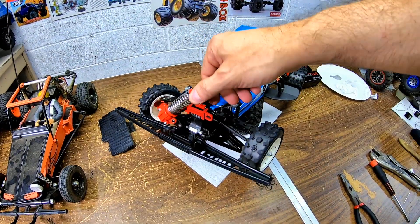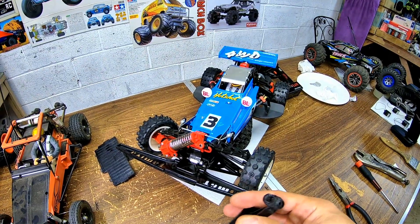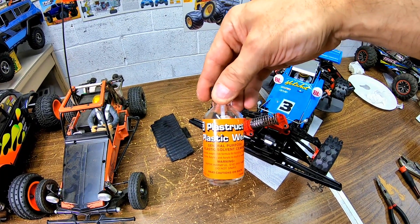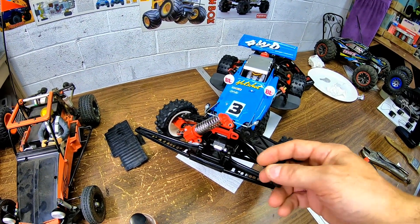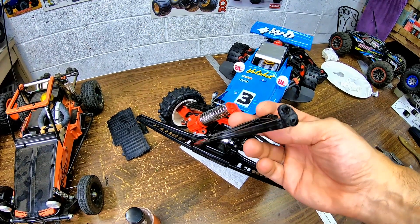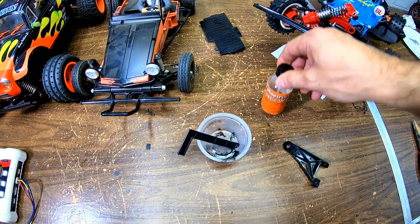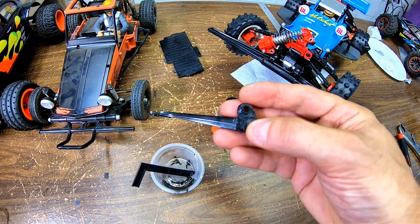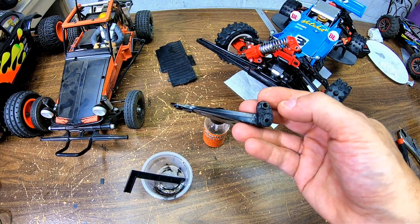So I ordered a new A-arm kit again with all the front A-arms. But what I did to my old A-arm — I said the hell with it. I used this PlastiWeld Plastruct stuff that melts the plastic together — ABS. After fixing it last time, I had the old one sitting in a box. I put some plastic shavings in there with the fluid and waited until it got gooey like melted plastic. On the front of this stock A-arm there's a hollow hole above it, and that's always where it breaks, so I filled that up with the stuff.